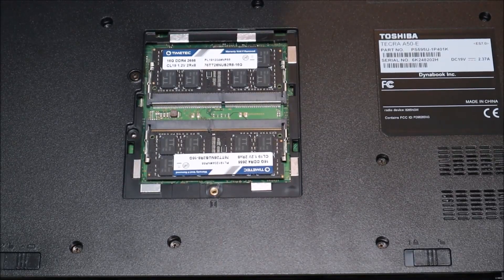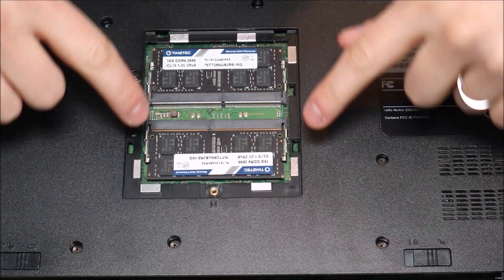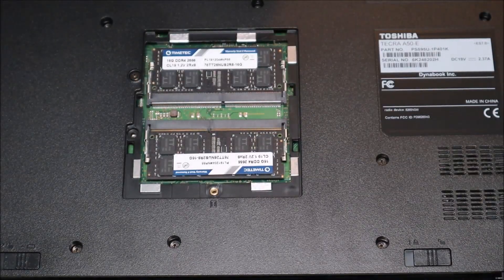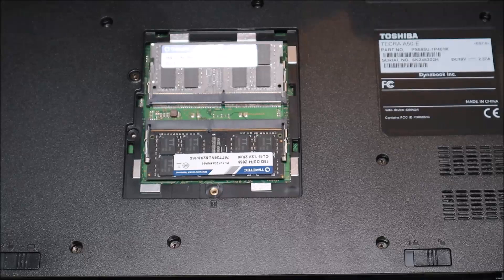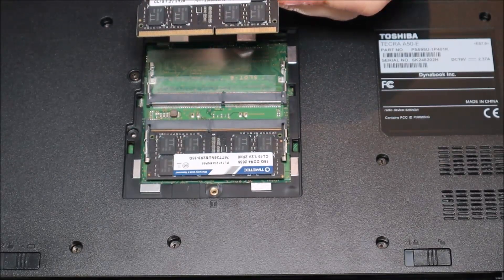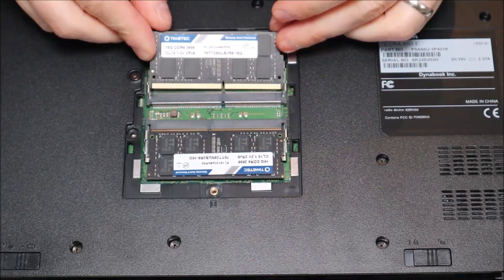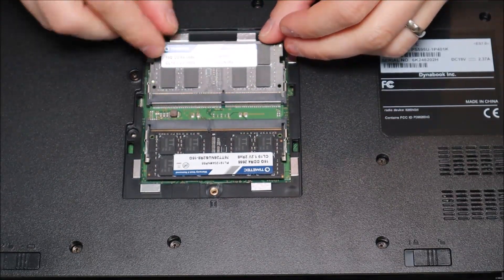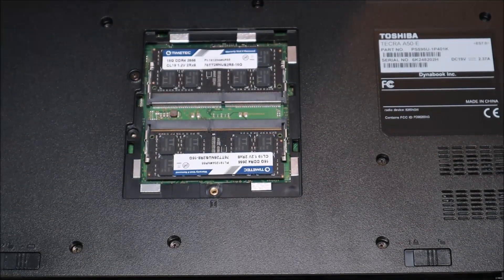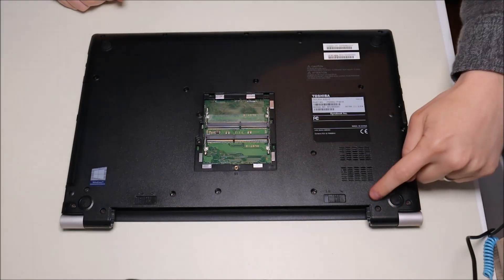This is how RAM in laptop computers usually looks. You'll usually have one or two ports; on larger computers you'll have more. They come with spring-loaded metal arms on the edges that hold the RAM in place. To remove the RAM, you push apart those metal arms and the RAM stick pops up. Then you just slide the RAM out. It has a long port and a short port so you can't put it in incorrectly — you've got to line those up. To put it back in, slide it in, make sure it's flush, then snap it down and the arms reattach.